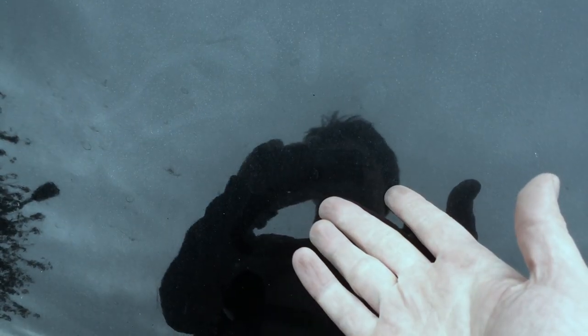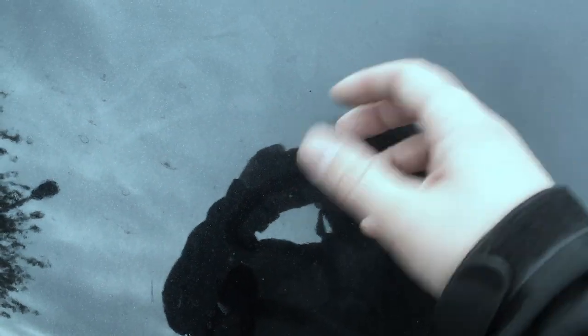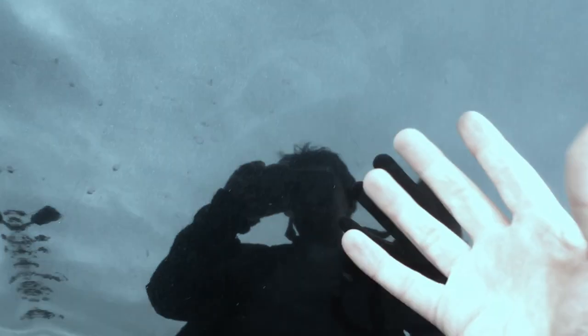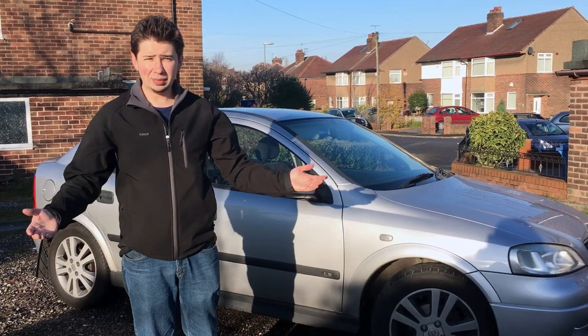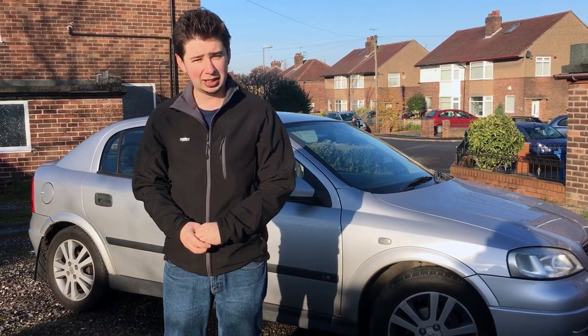I don't blame you for not wanting to wash your car during the winter — it's horrible in the cold weather. Look at the car, it's absolutely filthy. But it's worth doing one proper wash just before winter and then coating a layer of wax, because this is going to stop salts penetrating the paint and hopefully stop corrosion on the car. If you don't want to hand wash your car in the middle of winter and you don't want to go through an automatic car wash, just go to your local garage — they have pressure washers you can stick a pound in and have for a couple of minutes. Just give the car a blast over, get all that salt off, and keep the car nice and free from that, because salt on the paintwork is really the worst thing for your car. So there we have it guys — hope this video has been useful to you. Give it a like, subscribe, or leave a comment in the section below. Take care and stay safe.